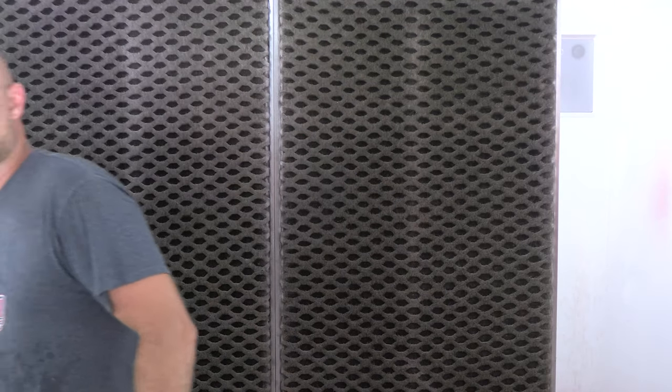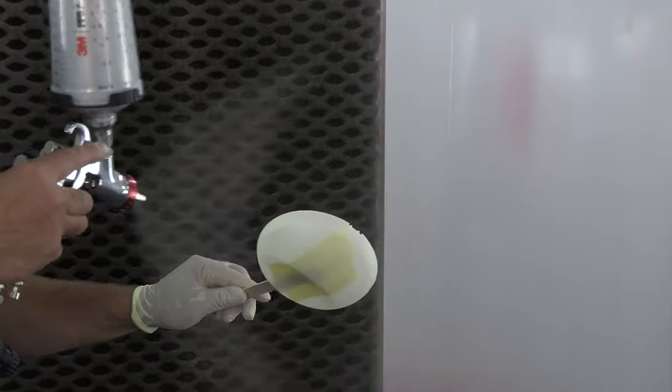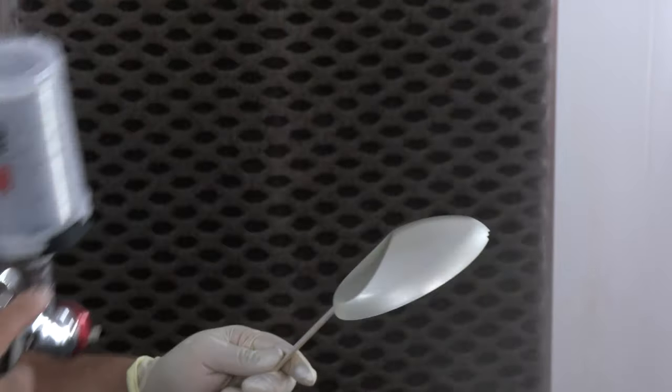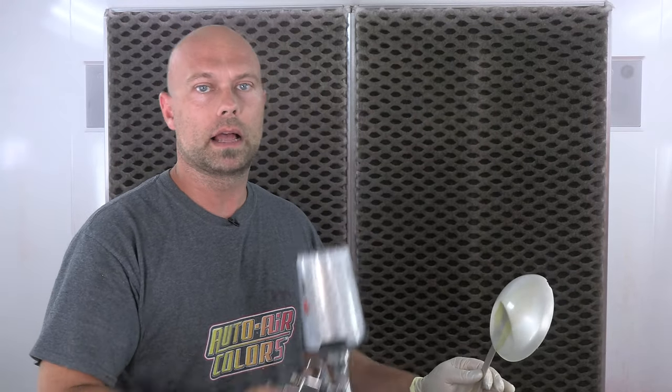It has great adhesion. I did about three coats — I'm going to show you what that looks like right now. I'm using my Iwata WBX with a 1.3 tip; it's a great gun for spraying this product. What I'm trying to do is just one nice even coat. It looks a little transparent now, but as that dries it's actually going to become really opaque. Three coats is going to be perfect: two coats to get nice coverage, and the third coat to give the metallic orientation.